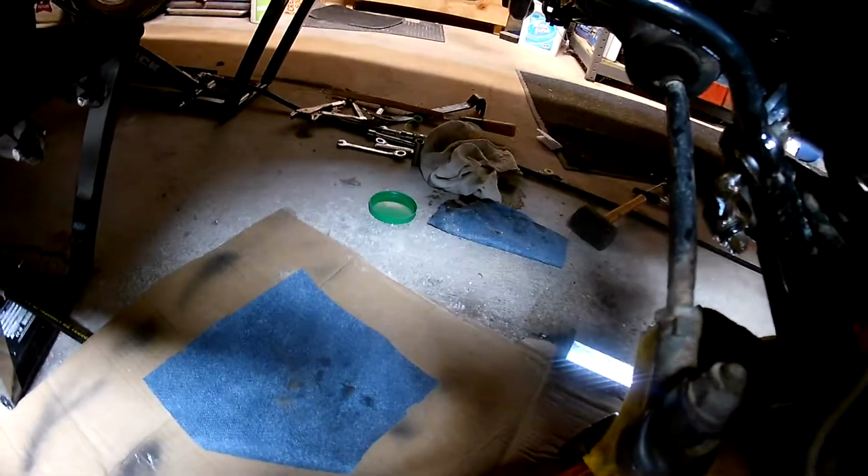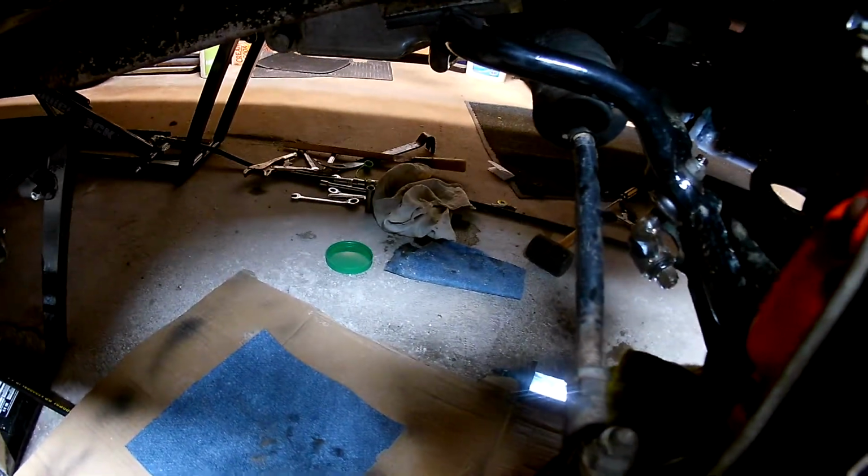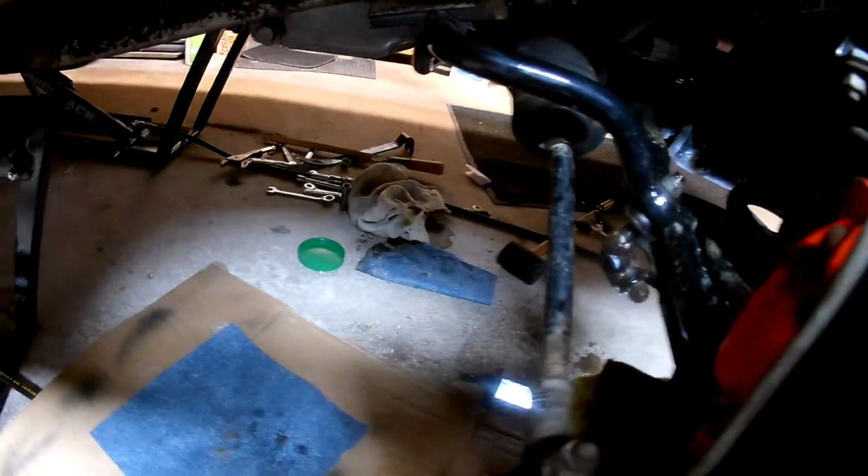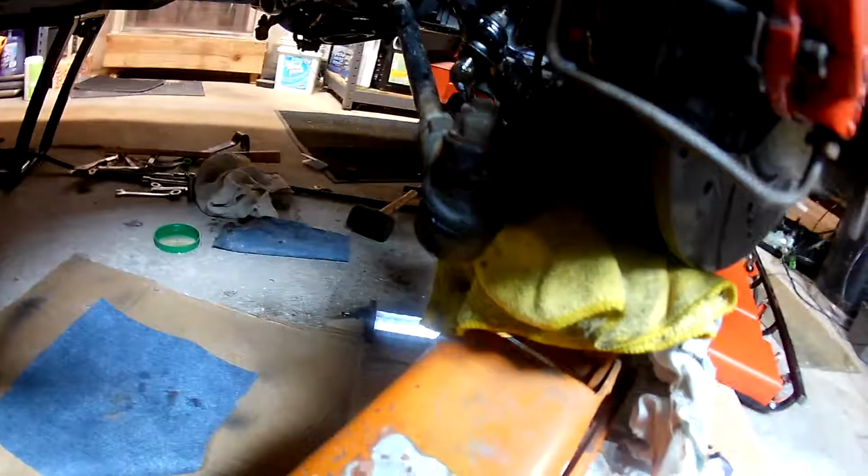I'm going to have you pump it up, and then I'm going to say stop, and you're going to go over there quickly and turn the steering wheel left all the way and right all the way. Okay? I'm ready to start pumping it up. This is the right front passenger side. We're going to jack this up with a trolley jack and look at the interference.